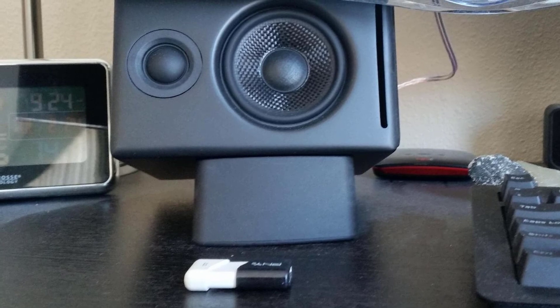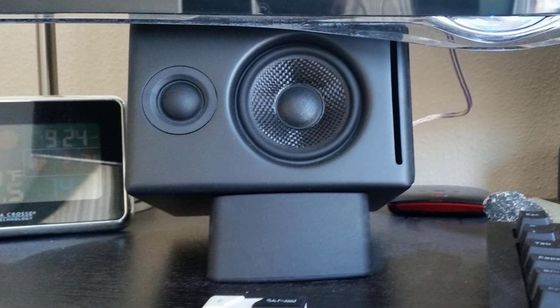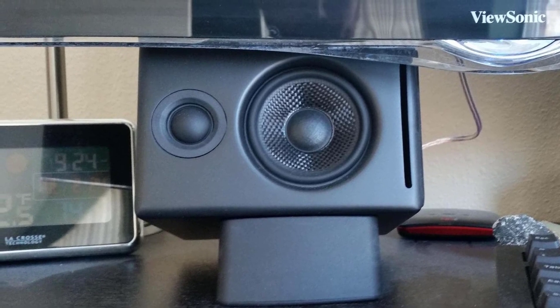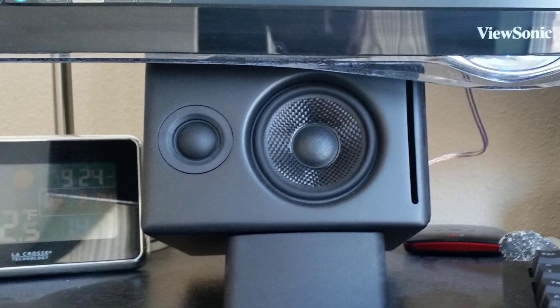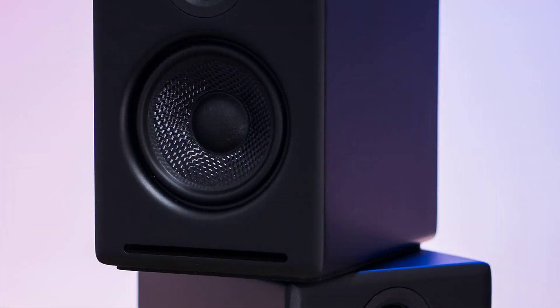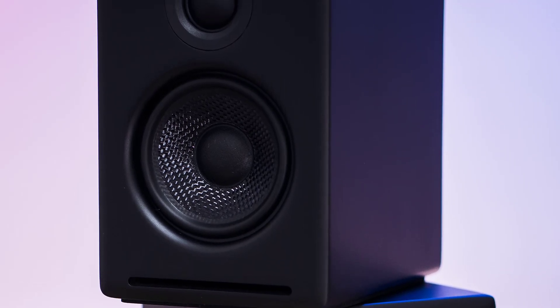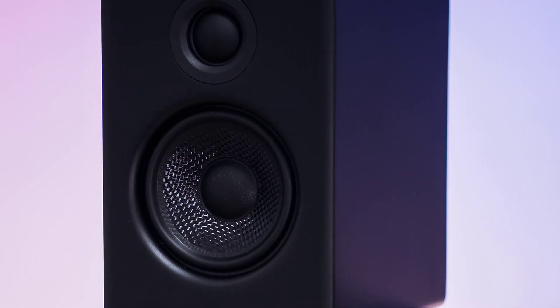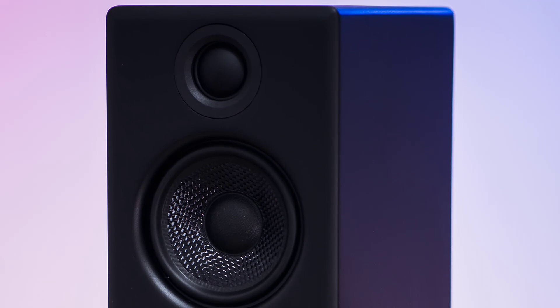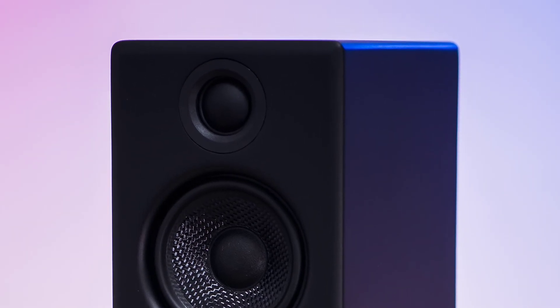The smaller 2-series is more stylish-looking than the 5-series and looks less like a monitor speaker, and comes in both black and white, as does the larger A5+. The Audioengine A2+ speakers measure 6 inches high by 4 inches wide by 5.25 inches deep. They each have a 2.75-inch Kevlar woofer and a 0.75-inch silk-dome tweeter. Because the left speaker houses the amplifier — 15 watts per channel — it's heavier than the right speaker.